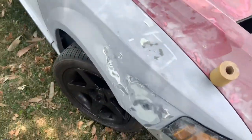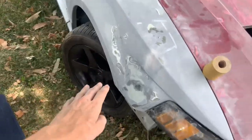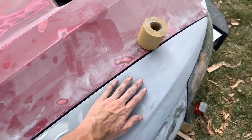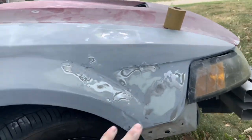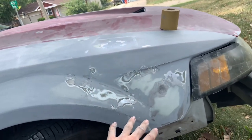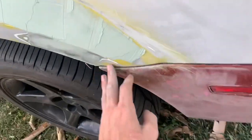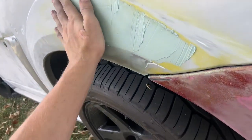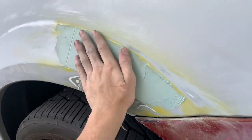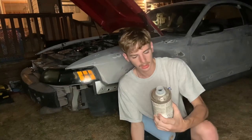It's the next morning. To start the day I'm going ahead and finding all the low and high spots, using some hammers to hit these areas down. We're going to fill it and sand it smooth because we're over this already. Before we fill the front fender with Bondo, I'm sanding down the area where I filled with Bondo for you guys last night. We'll see if we need to add a tiny bit more, then sand it down and we'll be back after that.